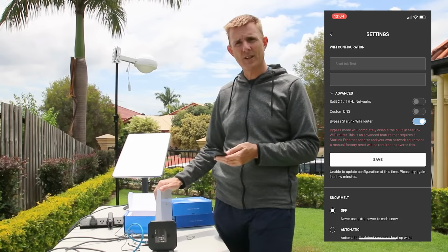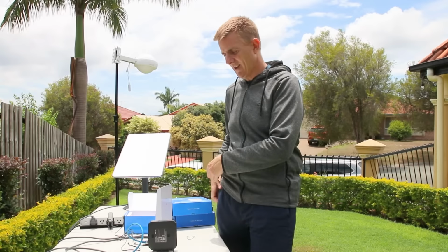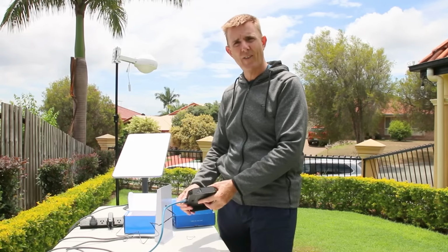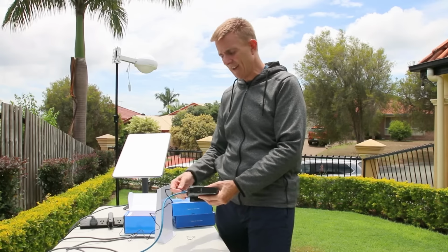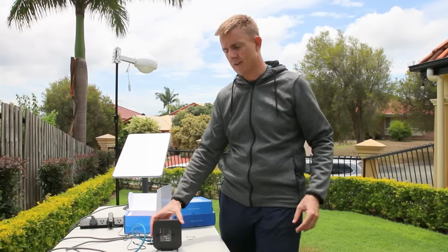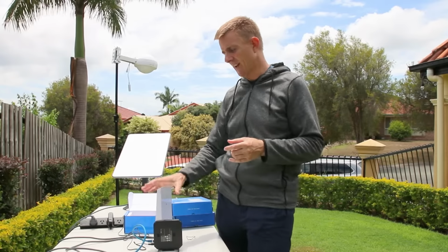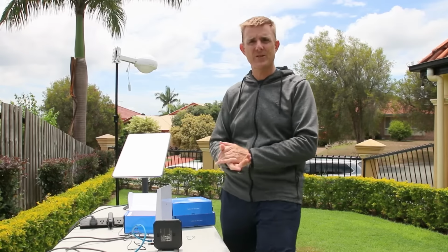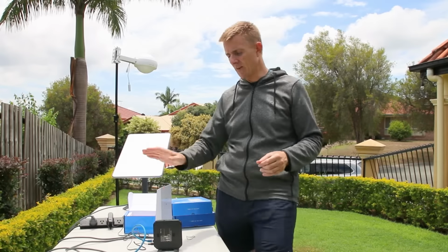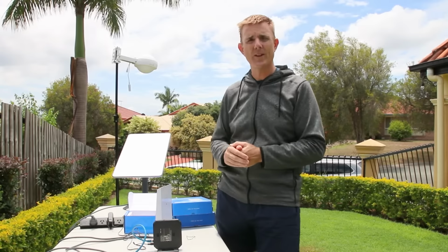The Starlink router is now no longer doing anything. Probably at this point, I would suggest we now power this off, and power it back on again. I just wanted to make sure it's now going to connect itself. It's going to bring everything else up. It's going to get an IP address from the Starlink setup on its WAN side, and now it's going to get itself up and running. You don't necessarily need to do the reboot that I've done. It's just a nice finish off so I know that it all works.